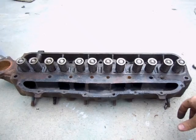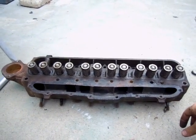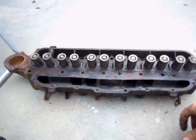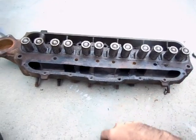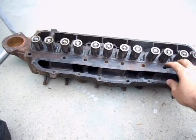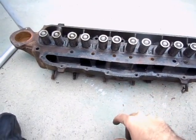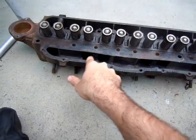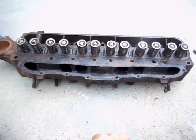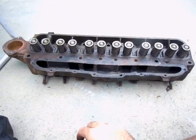I did recurve the distributor using an example from Tom Jennings' website, WPS.com — worth checking out if you're a Rambler fanatic; he's also kind of in love with this 196 engine. What I want to do is create a custom intake manifold, keep this plate here, and have three small throttle bodies — or maybe three small intake pipes running up to an intake manifold with a large throttle body on the front. Then mount some injectors in the spare spots, maybe 19-pound injectors — pretty much all you'd ever need for the 3-liter. Manage everything with a MegaSquirt system like an MS2E or MS3.